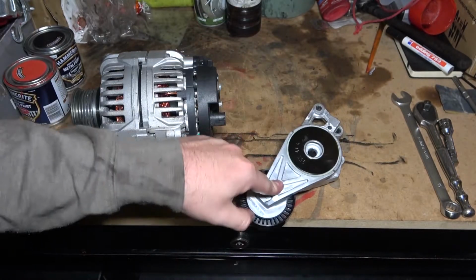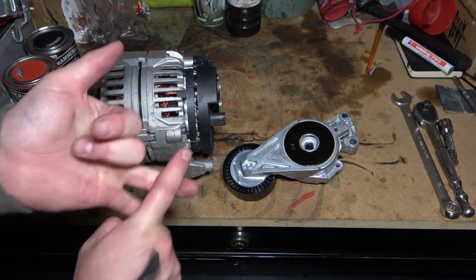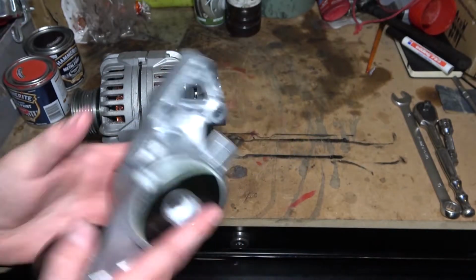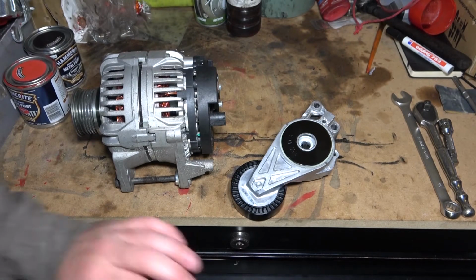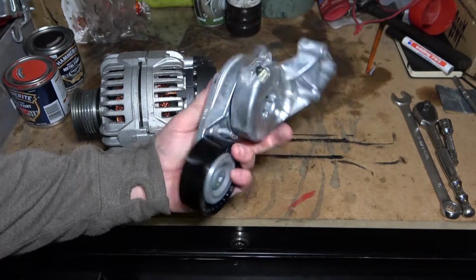Now I have. I can use that, change that, so then the car would have had a new timing belt, a new water pump, a new auxiliary belt as well, and now a new auxiliary belt tensioner. I also changed the tensioner and the dampener on the timing belt as well. So the whole side of that engine is now, or will be after this video, brand new.